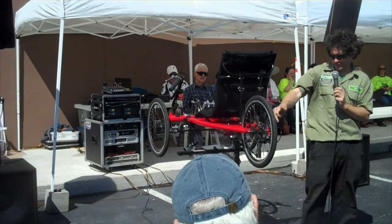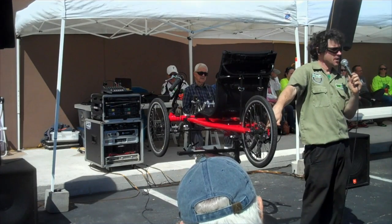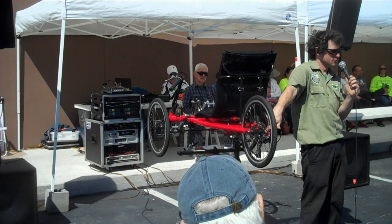If the low limit screw is too tight, it won't make it onto the low one. It hits that screw and stops.